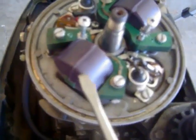And I'll also show where these wires are, where you can follow them for which coil goes to which cylinder. Normally, the coil on the top here, facing the cam follower here, this coil goes to the top cylinder. This back coil with the wire goes to the bottom cylinder.